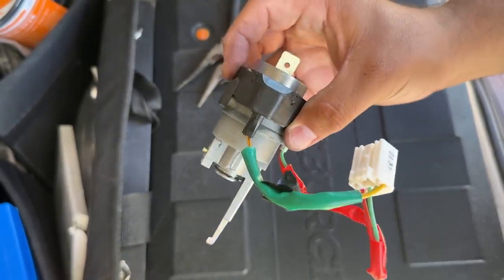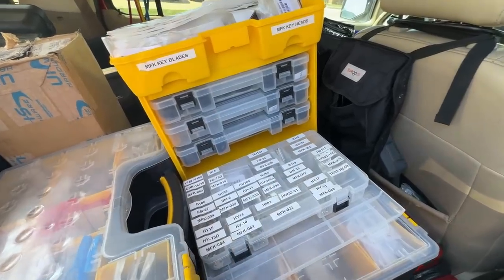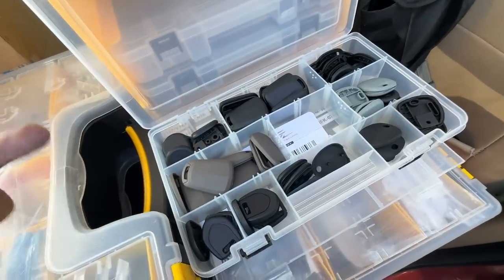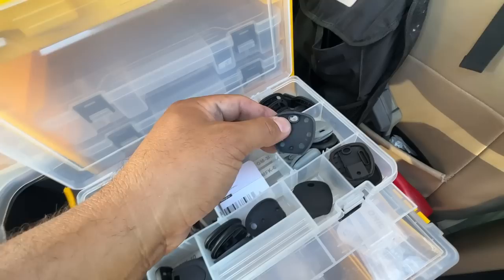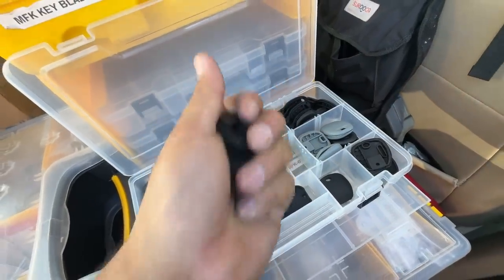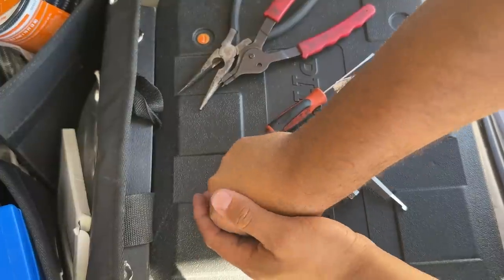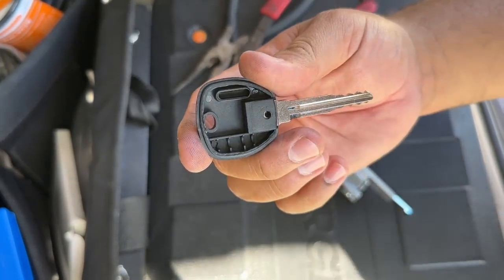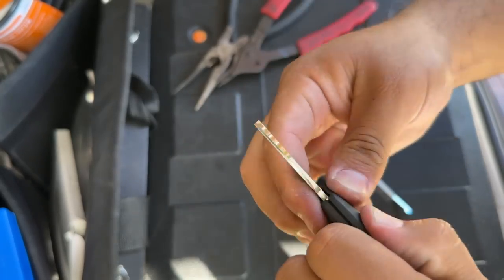About the key — there's no head on the blade because this is an MFK blade, and we use MFK heads. I keep the Hyundai/Kia style heads here, along with other brands like Mitsubishi, GM, Ford, and so on. We stick the blade into the slot on one half of the head, push it all the way in, then add the other half of the shell. There's a slot for a transponder chip, but since this is a Kia there's no chip needed, so we just clamp the two halves together.